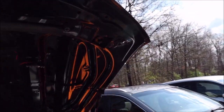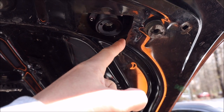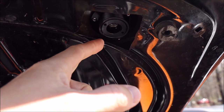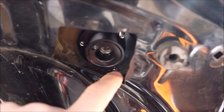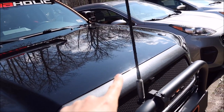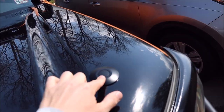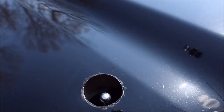I've got the driver's side all done and fitted. So I'll go ahead and do the passenger side. I widened the initial inch and a half circular cut into a sort of rectangular trapezoid to give me room to fit the pin in and enough space to get the allen key in to thread in all those threaded rods. Before you get to this point, just make sure you double check that the hood is fully closed with the factory latch and the hood pin in the correct position. Make sure the top of the strike lines up roughly in the center of the hole so it'll be easy to align with the bottom once everything is in place.